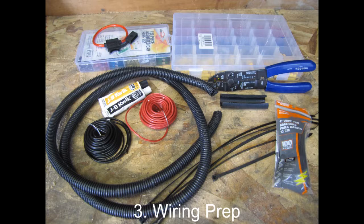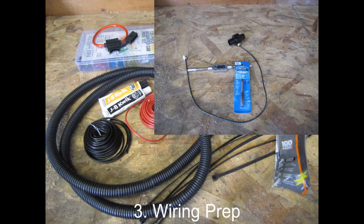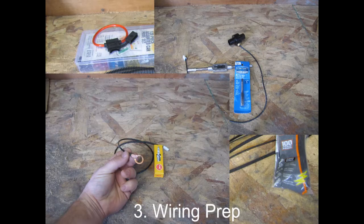If you're using the stock water temperature sensor kit that comes with your TrailTech Vapor, you're going to need to pull that sensor out and lengthen that line, running it in the same split loom as the primary wire for your power. Or you have the option of purchasing the spark plug temperature sensor — it's a more accurate way of getting a cylinder head temperature reading, and that's really what we recommend.